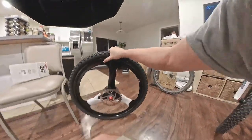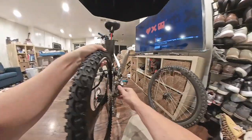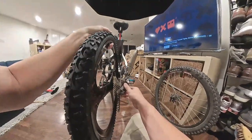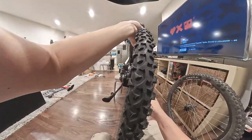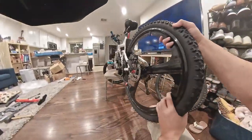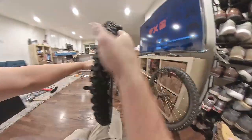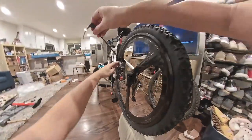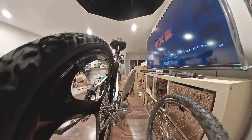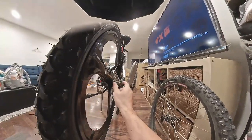I think that's it — I think we're pretty much done. Let's try plugging this guy in. I made sure I was at the first cog, first gear. Lift this guy up — I haven't done this enough to remember how to do this, but just line everything up in place, then seat it. That popped right in — that's good. Don't forget the springs. Cut in the quick release. Let's check out our chain line — it looks very straight on the ninth gear.